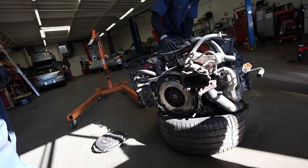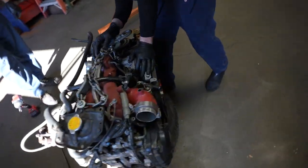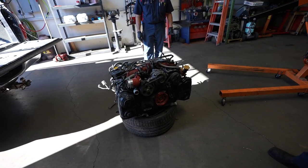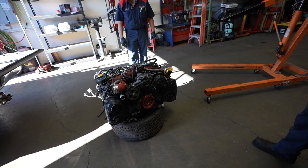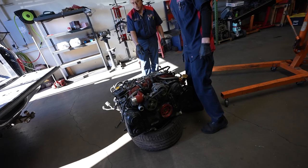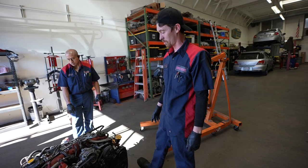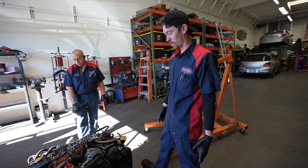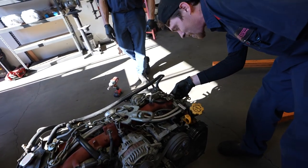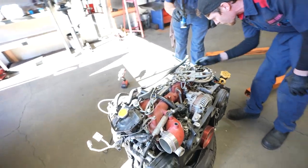They typically don't like lightweight flywheels — and here's another issue: lightweight flywheel and lightweight crank pulley. The problem is too much vibration in the crankshaft. The weight is there to keep the harmonics down; too little weight means too much vibration. That could have caused some issues, though not necessarily the valve burn or the compression loss — that was probably fueling, or timing, or something like that. The injectors look like stock, but they're probably drilled-out stock injectors.